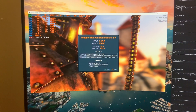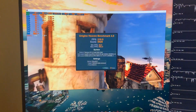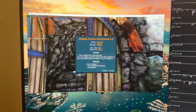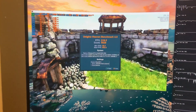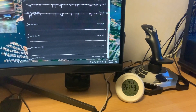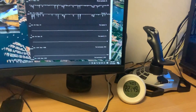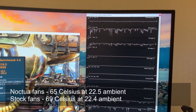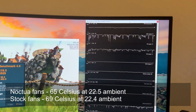I've been running this Heaven benchmark for about a couple of hours now just to get the ambient temperature up to what it was with the stock test. Unfortunately I couldn't show you the stock footage because I made several mistakes in it, however I do have the numbers to compare. Right now the temperature of the room is 22.5 degrees Celsius — it's actually 0.1 degrees hotter than with the stock test. The temperature of the GPU has maxed out at 65 degrees, whereas during the stock test the GPU hit 69 degrees, so there is a 4 degree difference.